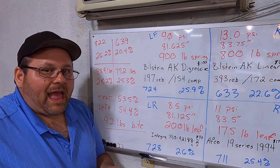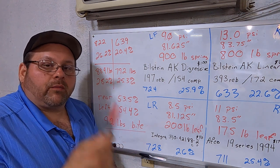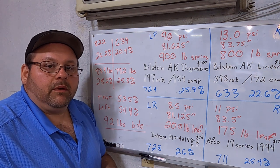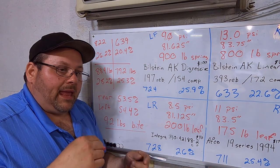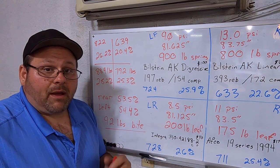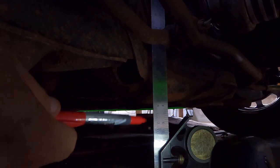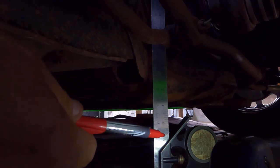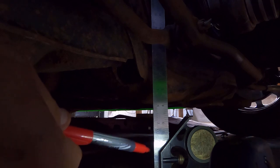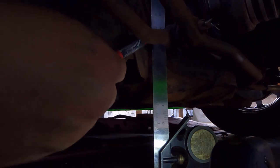For measuring front ride heights, I use a 12-inch steel ruler square — it's got a base on one end so I can sit it on the floor. I sit it where the ruler goes across my front lower control arm bolt, then reach in with a dry erase marker and mark the center of that bolt. Pull it out and read the ruler. I'm measuring from the center of that bolt — not the bottom of the frame, but a very accurate and repeatable place. The difference between the two front bolts tells you exactly how much left or right angle the car has.